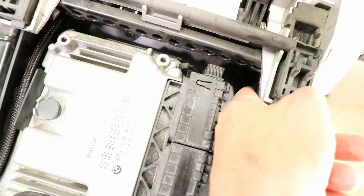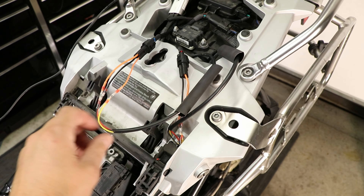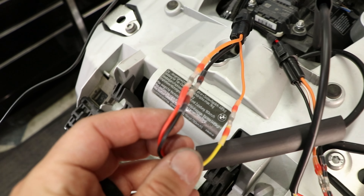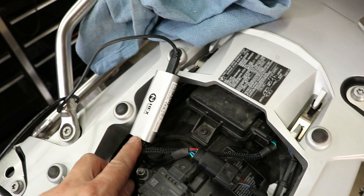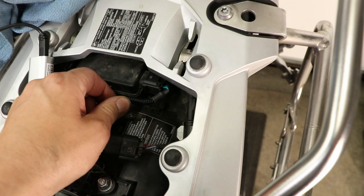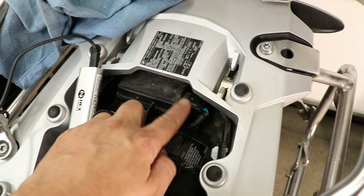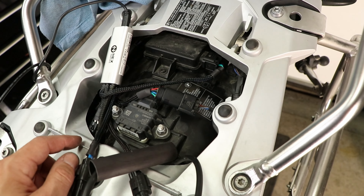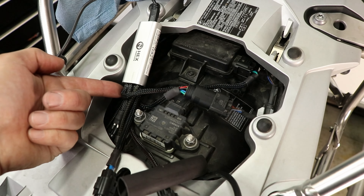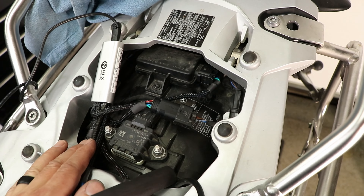There's lots of room up underneath here, and there are the splices. I'm just finishing my testing and haven't put the last piece of heat shrink tubing on yet. For the EasyHex CAN connection: you disconnect the RDC — the tire pressure sensor module — unplug the factory harness, plug it into the EasyHex CAN, and the EasyHex CAN has a connection that then plugs into the module. That's how it starts talking to the body control system.